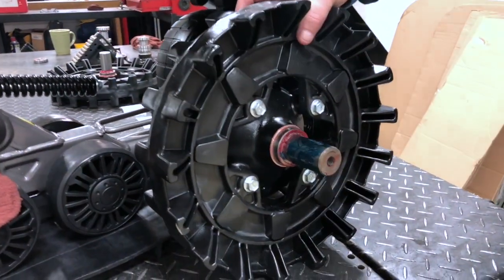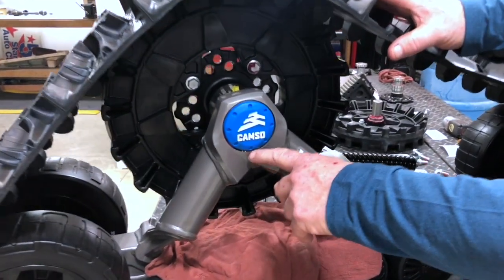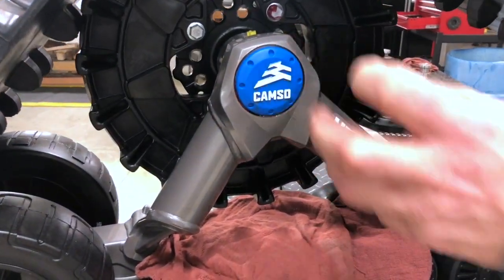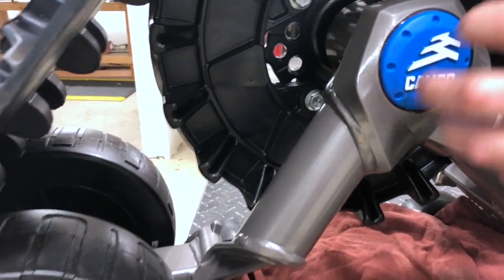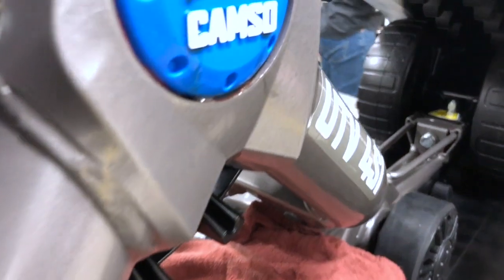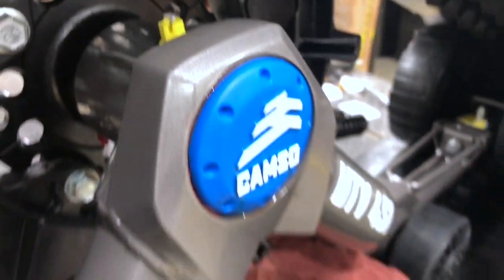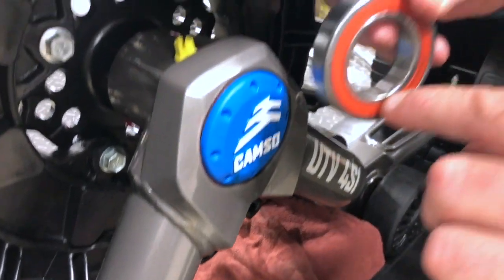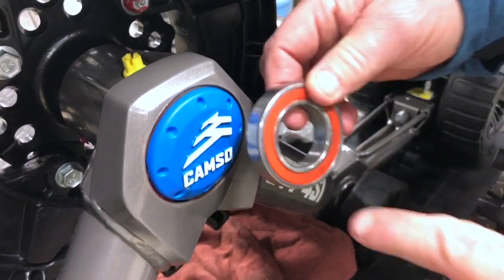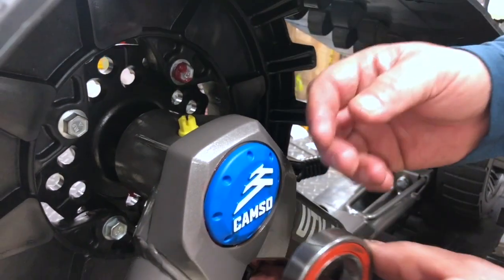So while Willie does this, I'll explain it. As you can see on new tracks, every now and then there's a little seepage right here — this is not sealed very tight. That's why if you put too much oil in there, it will leak until it fits. It will leak until the oil gets down to the correct level, then it stops leaking. So there's no harm in putting in too much, but usually five or six squirts is all you need.